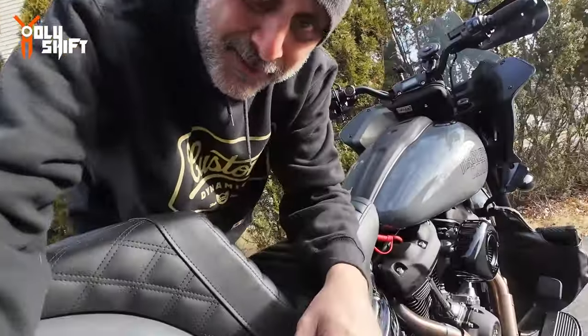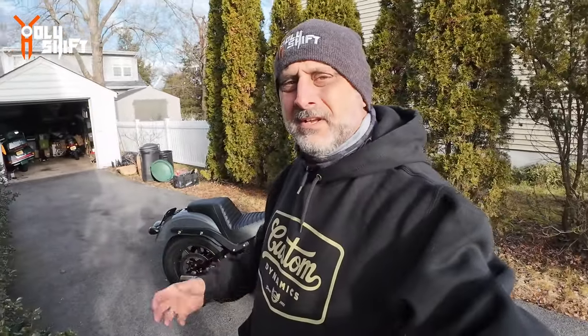I actually never checked it out myself. So today I'm going to take this bike on a trial — on the Low Rider ST. We're going to try to do this as scientific as possible: start the engine, let it run for five to ten minutes to get it up to idle running temperature, take measurements in a few spots, then start the fans — the Love Jugs — let them run for five to ten minutes, and see if there's a decrease in temperature.